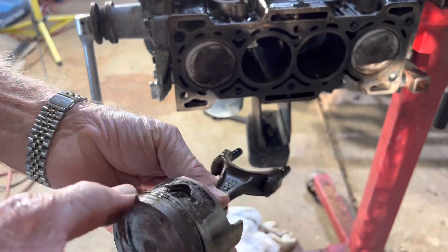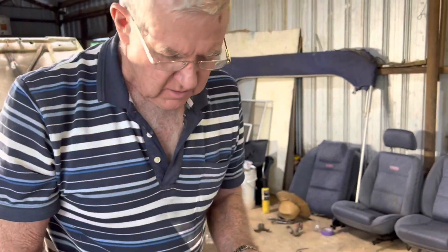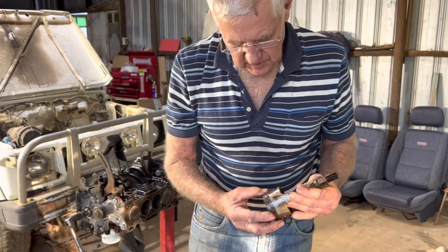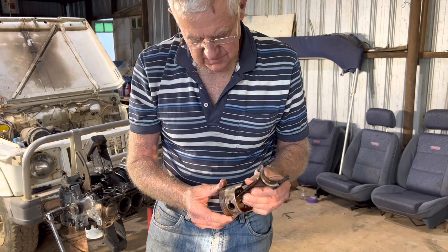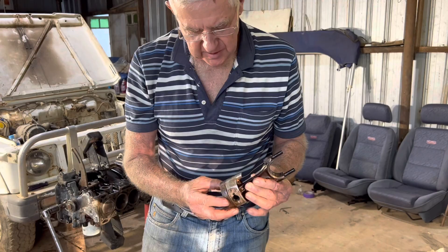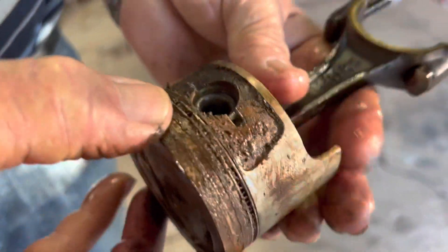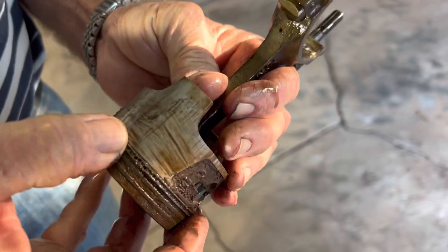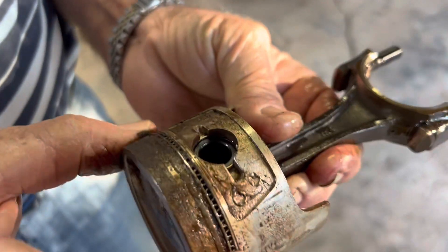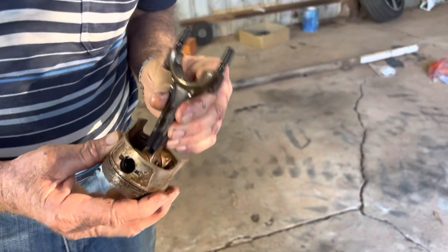What a baby little piston! Quite dirty in there. The top ring is stuck into the groove — all that needs cleaning up. So it's just as well we didn't just get the head machined and put it back together, because look what would have happened — it would have been a pretty bad experience and everything would have had to be pulled apart again. Look how those rings have been sitting for a long time with water in the bore — the rings are stuck into the ring grooves, I can't even see the gap. They'll have to be all cleaned up. The oil rings are pretty level with the piston too, but they're probably rusted in there as well. What a tiny piston!